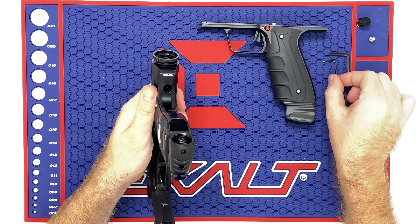Go ahead and take the knob. This knob can kind of be a pain if you haven't done this before — you've got to line it up with a small hole that's inside. Once you get it close, press it in. It has an O-ring of resistance, so you're going to have to press it and apply pressure as you're screwing it in. Once you get it into the hole, go ahead and turn it a couple times and you've got it locked in. This can be kind of difficult, so be patient on that one.